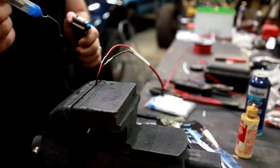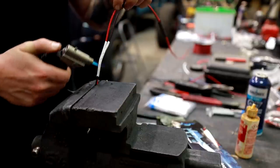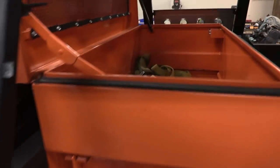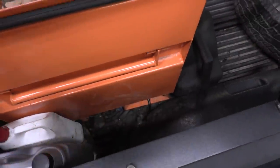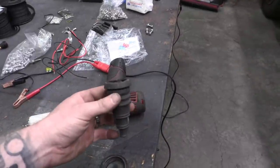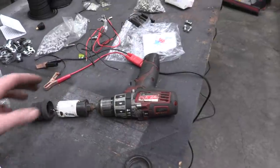After I twist the wires together, I like to give it a couple drops of flux because flux really helps the solder get deep into the joint. The flux starts to boil, the solder follows the flux into the joint, and then whenever it cools you have a really solid, strong connection. I then like to double up on the heat shrink — I put a little bit of heat shrink right over the joint on each wire, and then throw another piece that goes over those two to make sure there's no chafing. Now I've got to drill a couple holes to pass some wires out of the box into the back of the bed and then through the bed down below. I'm going to use a Christmas tree bit and drill it out to the size I need to pass the wires through, and then use a grommet to pass through the bed — an inch and a half hole should be just about perfect.